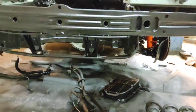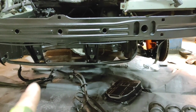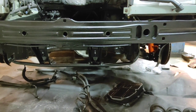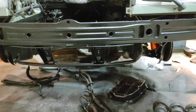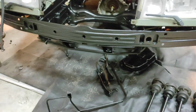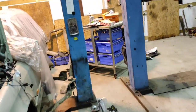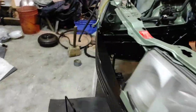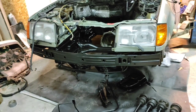The other thing that I might do — I've been looking into — is I might be going for the Diesel Pump UK brackets for the intercooler. Because I think I'd be kicking myself if I start cutting into the bodywork just to fit the intercoolers, when you can just get a bracket that goes — you can weld it into place. So I might do that, and then that might give me the facility to keep my air cut. I'm looking into it at the moment. If that's the case, I'll probably just sell the 300ZX intercoolers that I have there — that's them there. I might just sell them if I go for the other, and then just buy a standard off-the-shelf intercooler that fits into that. The only thing is it's quite costly to do the Diesel Pump UK ones, but then maybe it'll just save me an awful lot of headache in the long run.